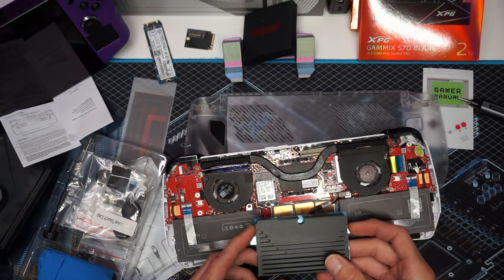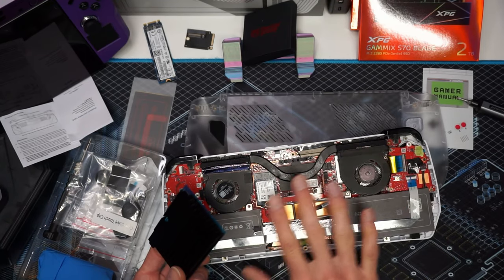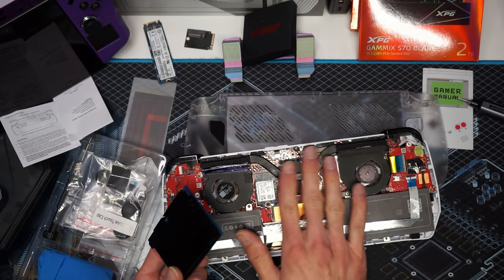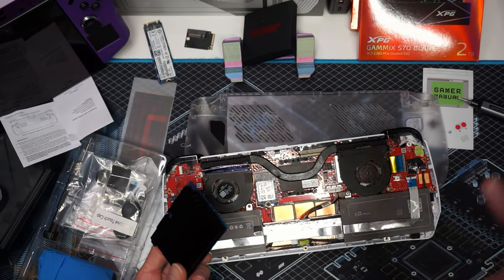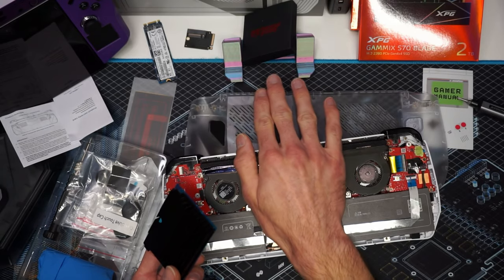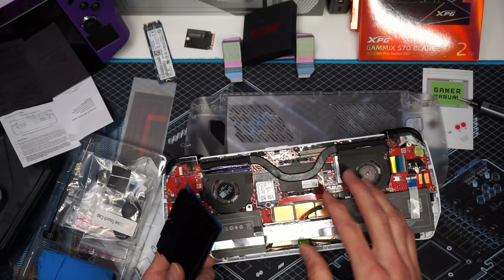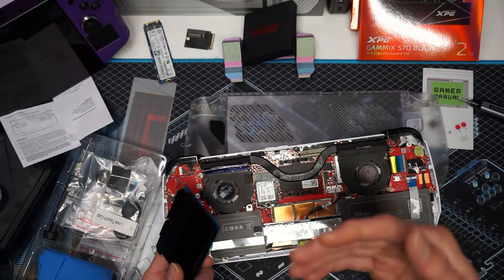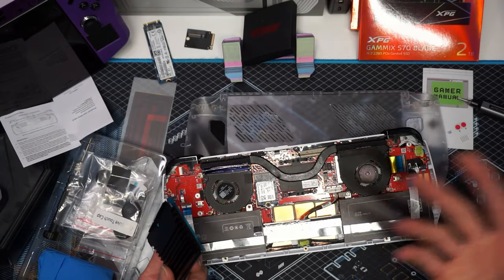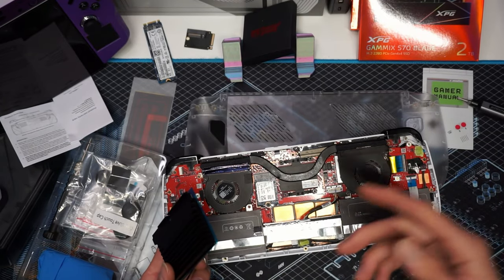But let's show you how this would go on. If you have the Chonky Boy mod, just go ahead and remove it. Label, leave it on — it's fine, doesn't make a difference. Now if you have the black flap still, take that flap off. That flap actually just traps in air and it is really just a dust shield. It's something I always remove and a lot of other people remove too, and it does allow for airflow to come through and keep things a lot cooler. So definitely just remove it. If you get dust in this thing, just blow it out with a can of compressed air — just keep your things clean.